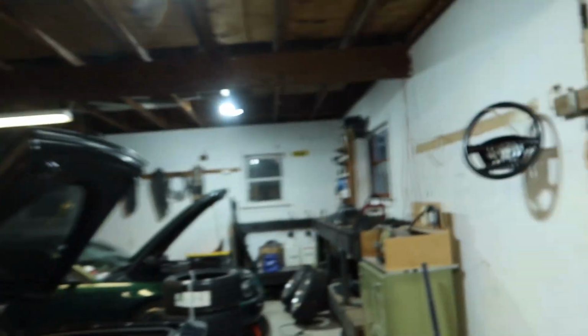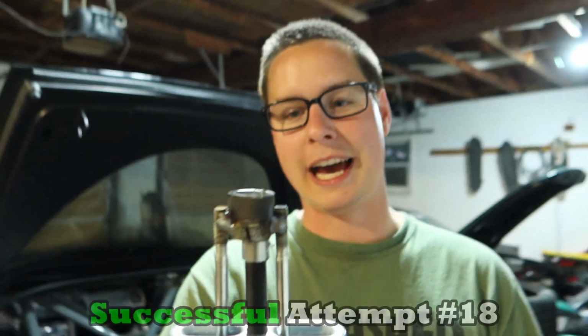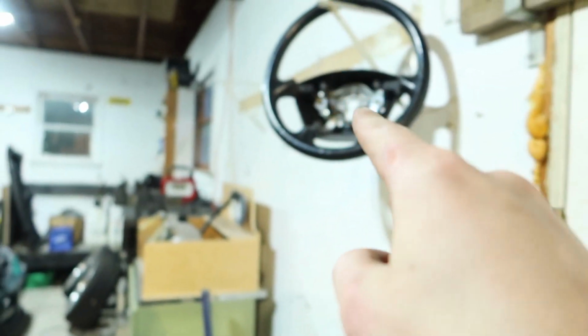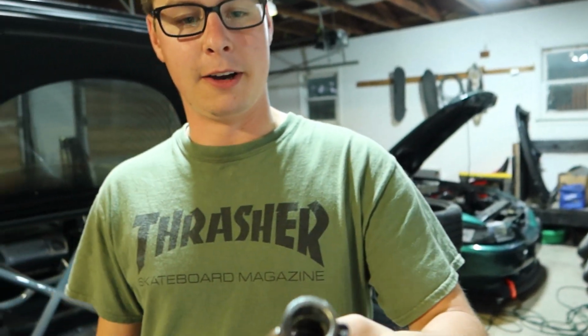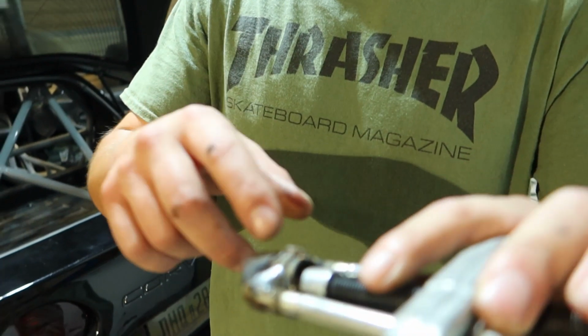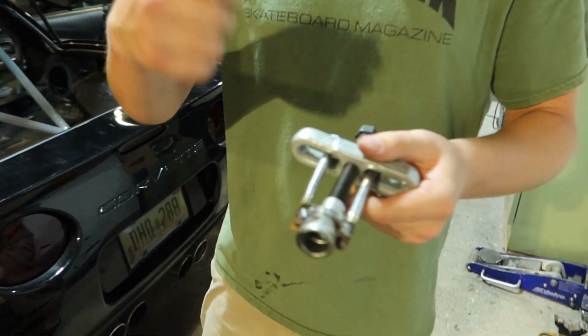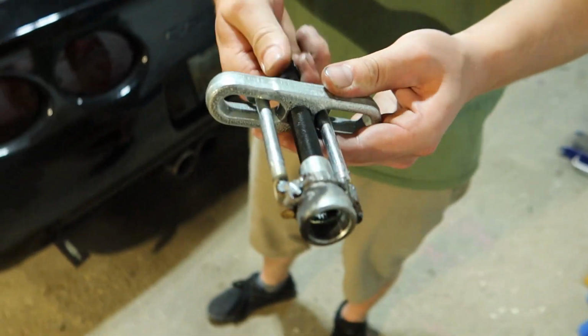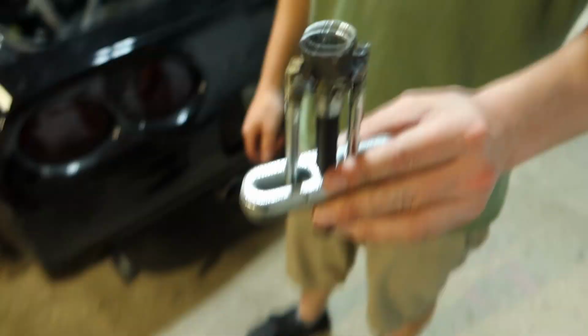All right, so after countless tries, we tried a slide hammer and we tried 2 different configurations of an actual puller. Steve completely broke the steering wheel. Yeah. So here was the actual solution. That's the spline portion that used to be inside of that wheel. And me and Steve wailed on this. We tried cutting it and splitting it with a punch. That didn't work, so we had to actually weld these bolts to the sleeve and then use the puller to get it out. That was terrible.